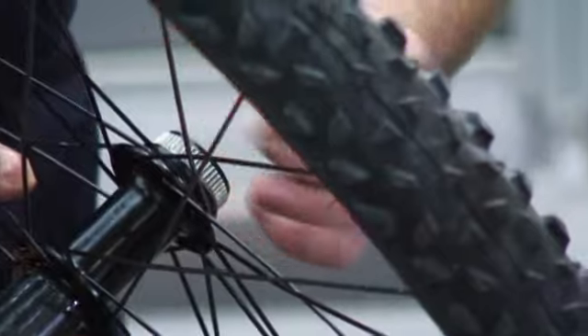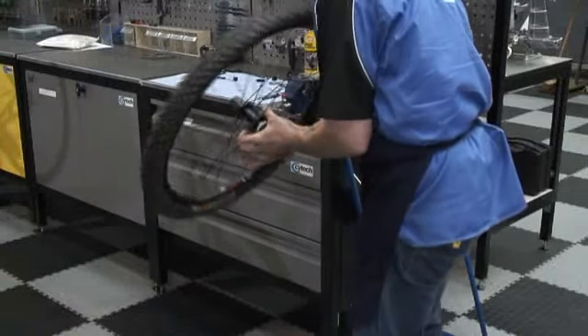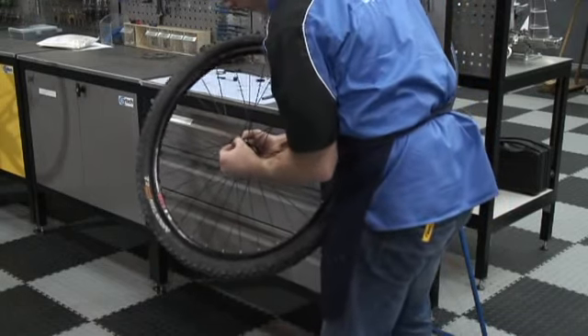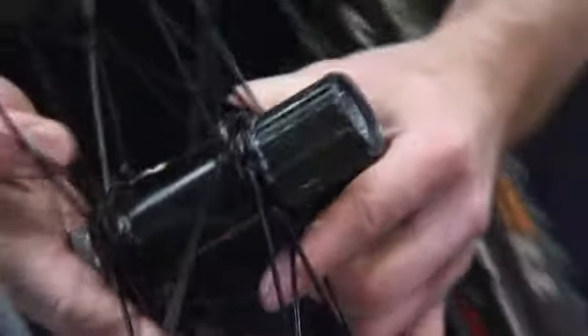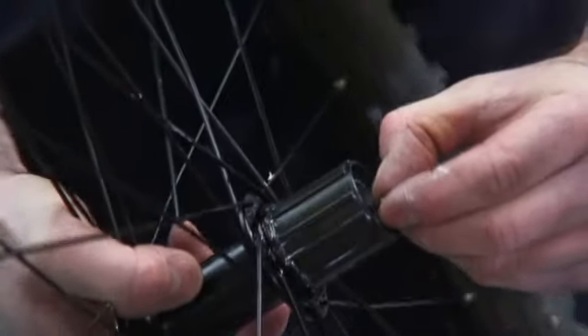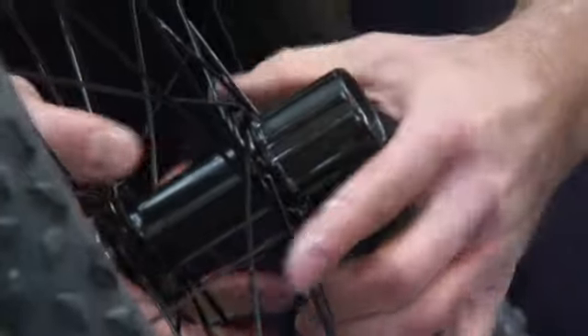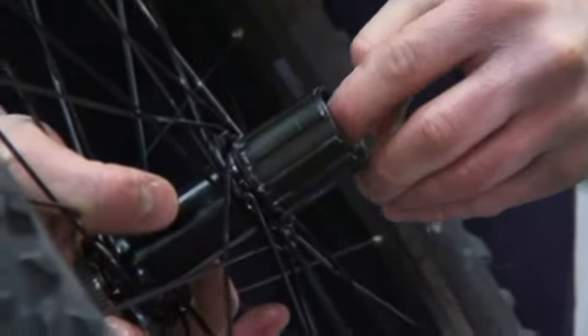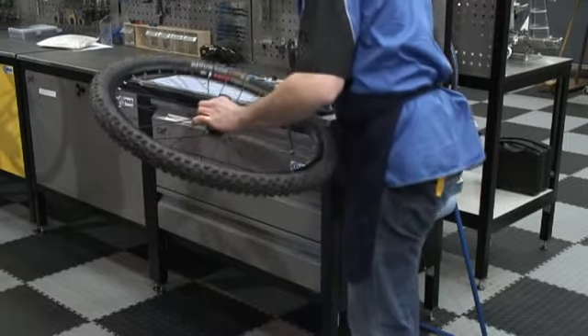Same on the other side — just push the grease onto the bearings, being careful with them. You'll feel the bearings seat themselves in the race. Turn the hub over and put the bearings in the other side — a little bit fiddly, this one takes a bit of patience and lots of cups of tea. If you've got the wheel at a decent angle they should fall onto the race. There always looks like there's room for one more bearing — don't be tempted to drop in a slightly smaller ball bearing, as you'll crowd the other bearings and cause damage. Put some grease over the top and work that in.